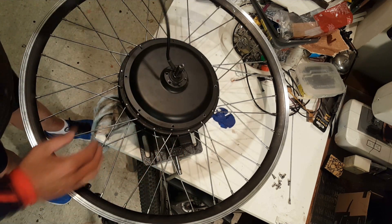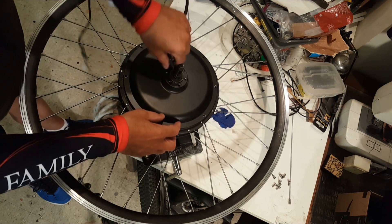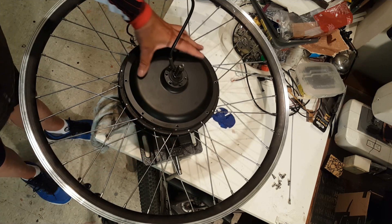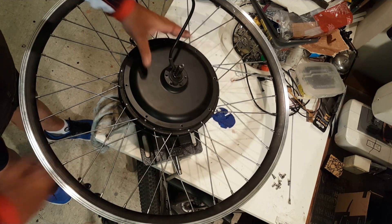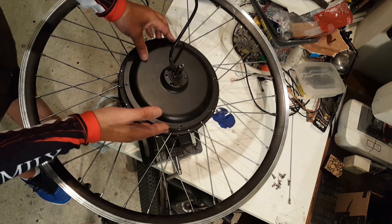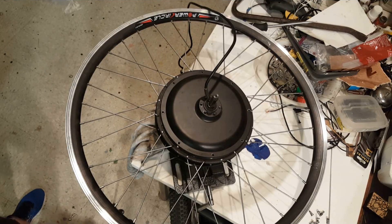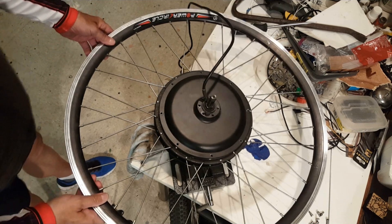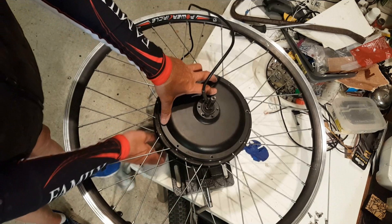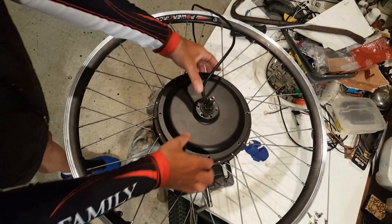What we're looking for is any wear on the phase wires and any wear on the sensor wires. I do this about once a year — it's kind of an annual check just to make sure there's no dirt and grime, that the wires are all connected, and nothing's burnt out. There was no particular problem, but I just want to double-check. The best way to work with the wheel is to have it secured to a vise with a rag around the axle so it doesn't damage the metal.